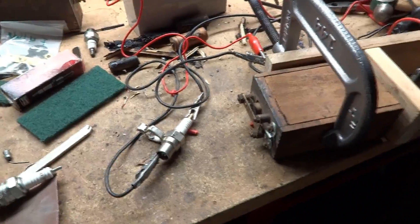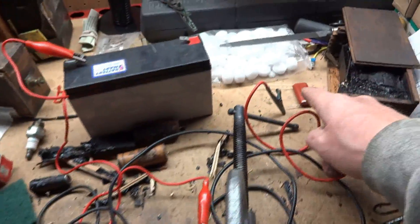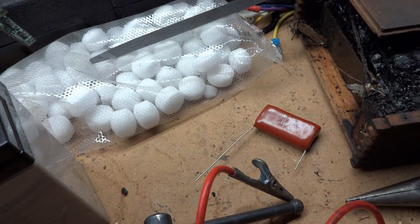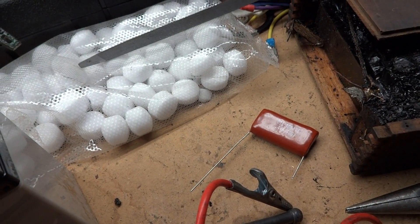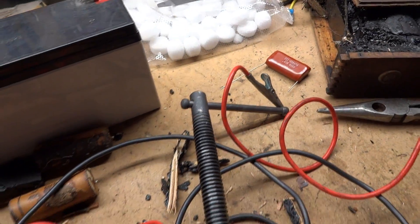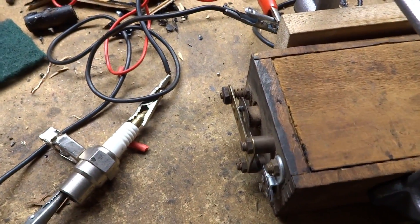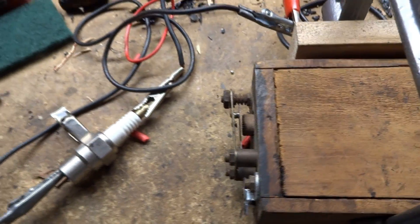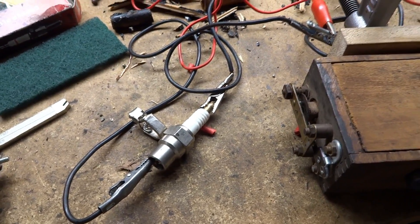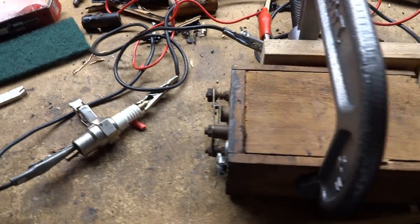About an hour has gone by since I started this video. I did put in one of these 400-volt, 0.47 microfarad capacitors. Those are what the Model T guys use, and they have a dV/dt rating of 1,700 volts per microsecond. That allows the capacitor to work at its maximum capacity, and then it allows the coil in turn to generate a spark much better and much hotter. When I do these coils, I'm doing them for two-cycle engines and motor car engines that run top end around 1,800 RPM. I've been doing them for almost 10 years with no problems.